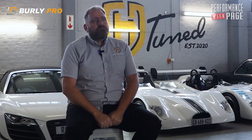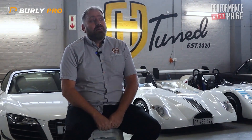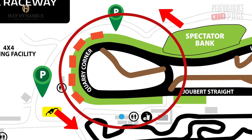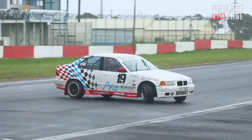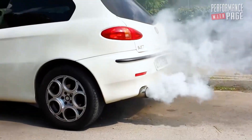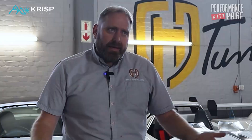If you were to go right around the oval all the time, the oil would be forced down to the sump. If you go left, the G-forces hold the oil up in the cylinder head and it can't drain — there's no pump, just gravity. If you take an E36 M3 with full oil and go left around the oval flat out, you'll fill the tappet cover, it'll hit out the breather, and it'll just smoke like hell and wet your air filter with oil.